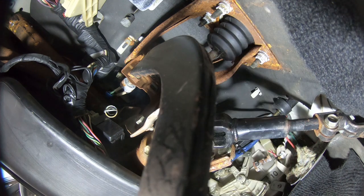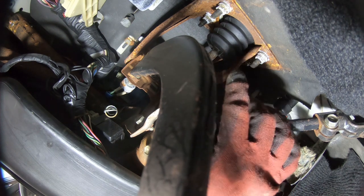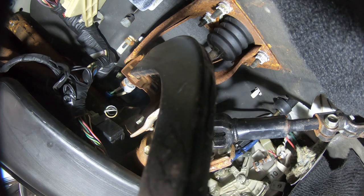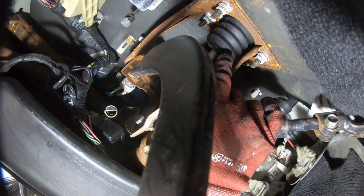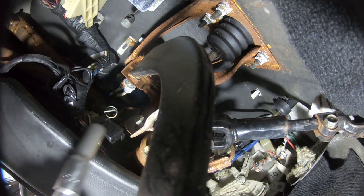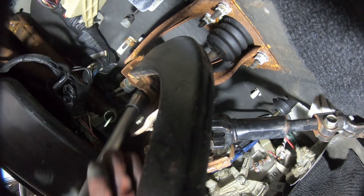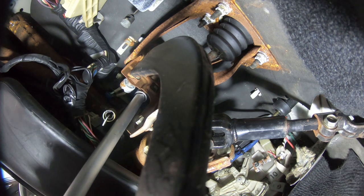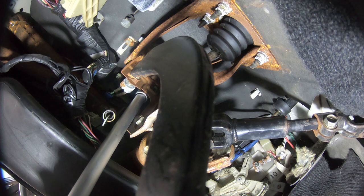There's a lot of rust on this. Apparently it's really common for these to fail, and when they fail the tell is the brake pedal assembly is rotten and the brake booster is quite rusty - and I've got both of those. But then you look at these boots and stuff and they look quite new. My parts guy reckons it might have been rebuilt, in which case tidy it, but we don't know until I've pulled it apart.